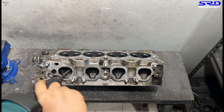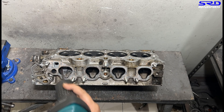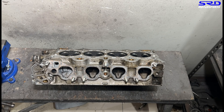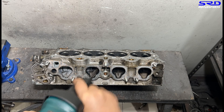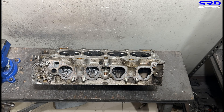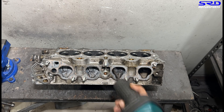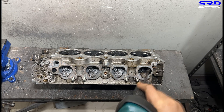Now we're getting ready. We start with the carbide first to get the shape going. Not really quick, so that it doesn't waste too much time. When you're going with a carbide at this point you can actually feel the bumps or the ridges on the core shift. This lets you equalize it better before you hit up the 80 grit on the sanding roll.